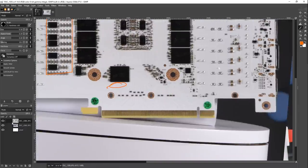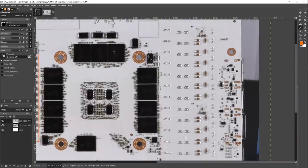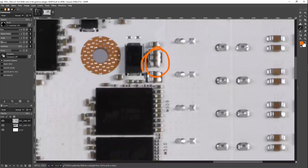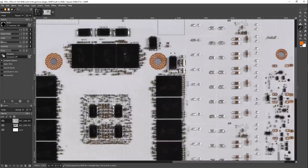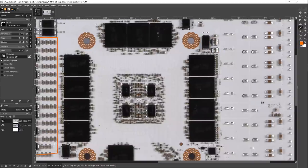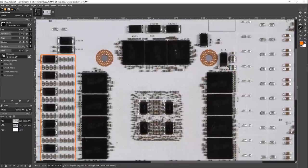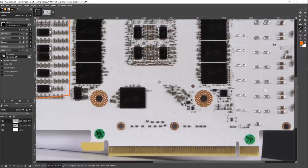I'm surprised there isn't one hanging out down in this area, though I guess this chip is close enough as is. There are a lot of capacitor pads that on most cards aren't populated at all, because they're considered optional — they're not necessary for stock operation. But if you're building a card with the goal to run the highest possible memory frequencies, you're probably going to populate as many capacitors as you can. So this card actually fills those out.